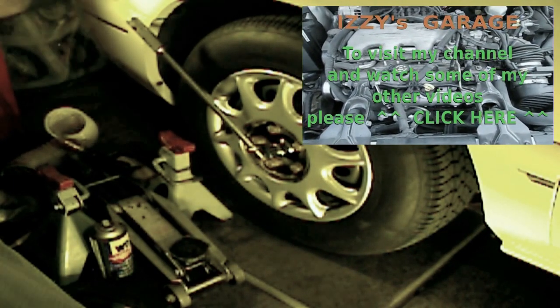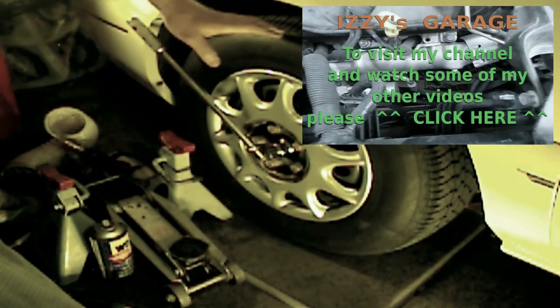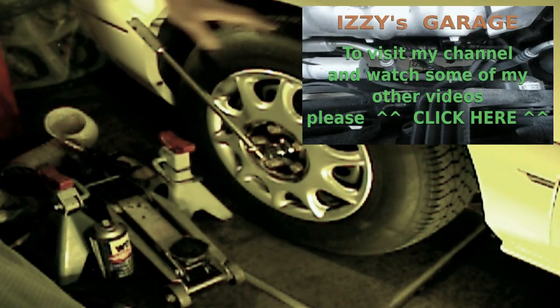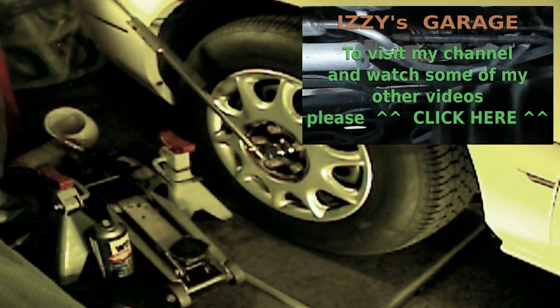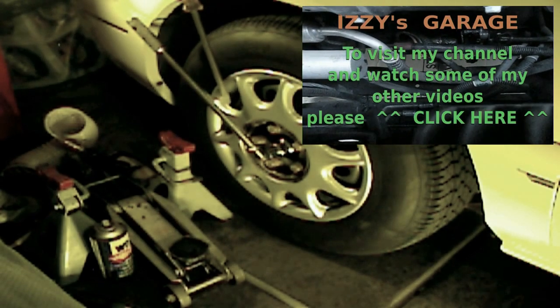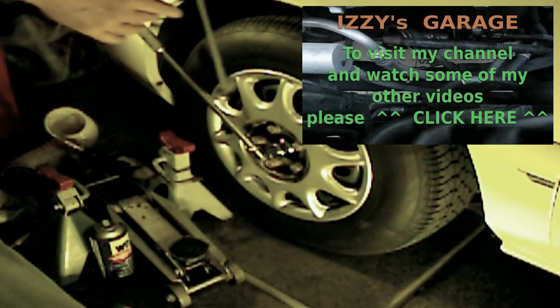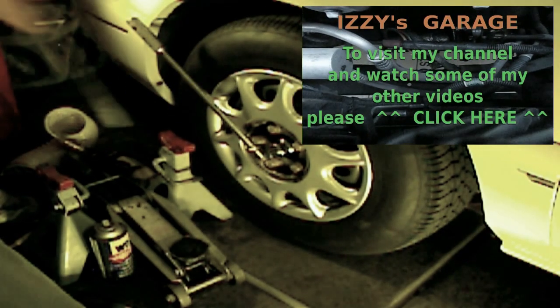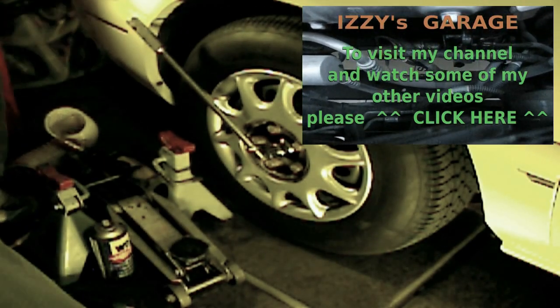And there's a third way also that I know of. Once you take the tire off, you can place a large screwdriver or a pry bar in between the fins of the brake rotor, and that'll also keep it from rotating and help you loosen it.